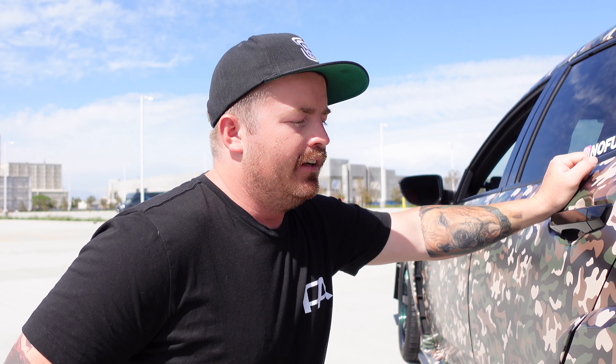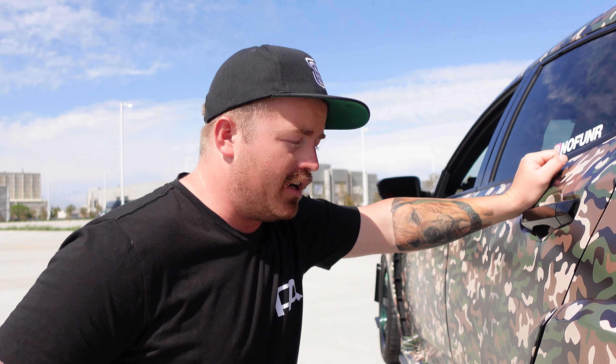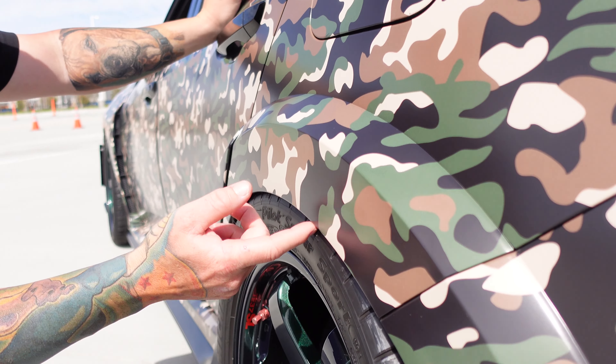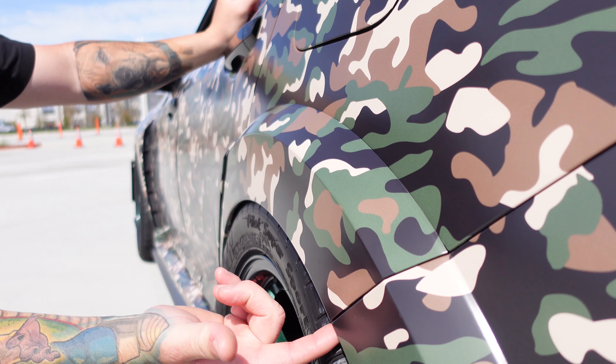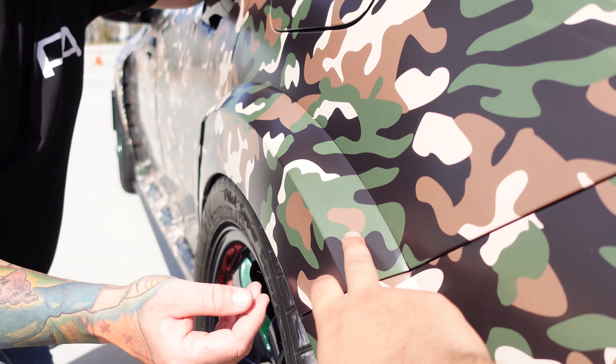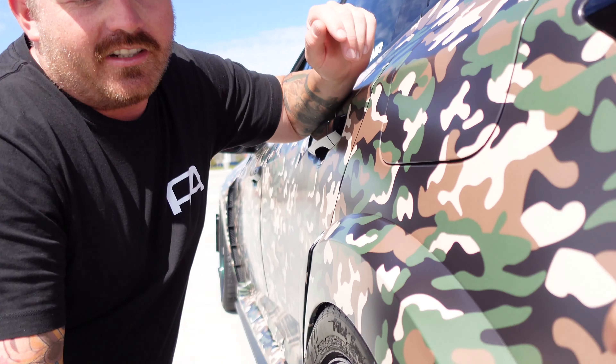On these, you don't really roll this car the traditional way. As I watched Mr. Sexy do it, it looks OEM — he trims it. This piece right here is literally only as thin as it is now, versus OEM where it's thick like a normal tab. He trims the metal underneath, cleans it up, and puts something on there to keep it from rusting. You could try it yourself, but you'd better know what you're doing — if water gets in there it's going to start rusting from the inside. This car isn't like an S2000 or NSX where you use a wheel roller — he had a wheel roller and didn't use it at all. It's a plastic piece you have to literally cut.